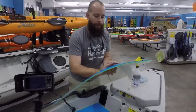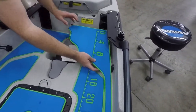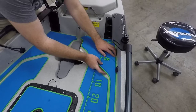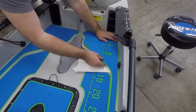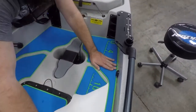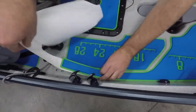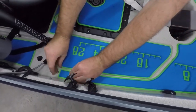We're not going to touch that back — we want to get that set down. We'll watch that tail end because on this application there are some screws back there. Make sure we get squared up all the way up to the front. You've got to watch the roll in the edge there, make sure that's not going to get into it. We're going to apply that in the direction and make sure that one stays back — that's going to prevent any issues with air or getting a stretch or a crooked lay.